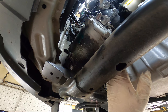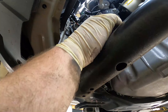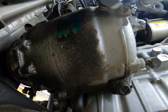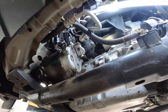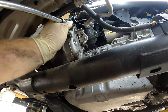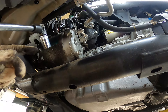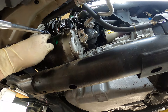Next, we've got four bolts to remove and then it'll be out. They are super dirty but they are 12s. The bottom bolts are very easy to access — they're right there. The top bolts are a little bit covered up by the subframe, so I'm going to use a 3/8 impact with a universal joint on it. I'm going to take the top two bolts out first because I usually like to start with the harder stuff.